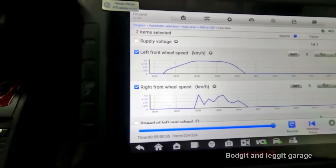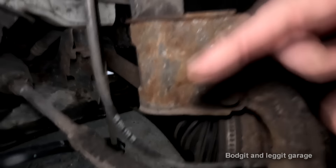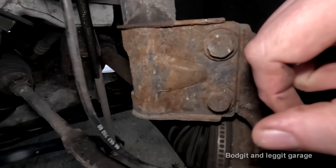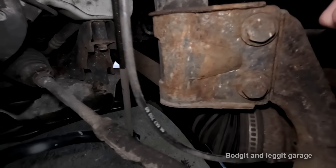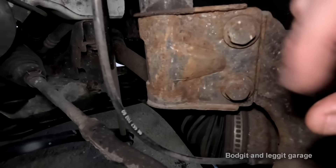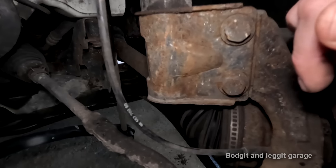The most important thing is this is the issue, so let's get it sorted. I'll try and get some close-up pictures, but basically that gap is about three, three and a half millimetres where it should be maybe one millimetre - it is twice the size of what it needs to be.